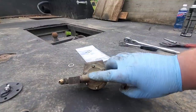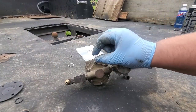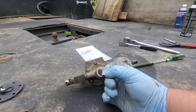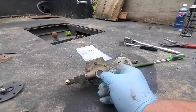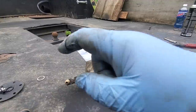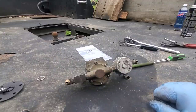I forgot to record it going back together. So this 7/8th plug back here, there's a little tiny spring under it, there's an O-ring in the end of it, and this plunger rides in it in this direction. The little button sticks towards you and the seal goes forward. When I put this together, I'm trying to keep all the parts together so I can put them back in their bags. It came with a fiber washer. The fiber washer would fit under this plug, but it's also got an O-ring there to seal, and there wasn't anything under there to start with. So let's make a phone call and see what that's supposed to be for, or pull up the manual for this bus. I'm not sure exactly where that goes — I would assume it goes right here. It's the only place it seems to match up, but there wasn't one there to start with. Usually when I take stuff like this apart, I kind of just try to match up parts as I take them out and replace them one at a time.